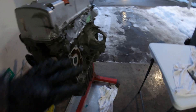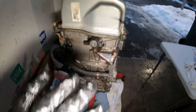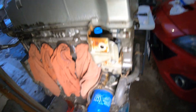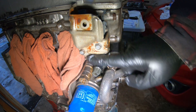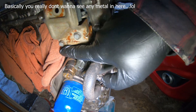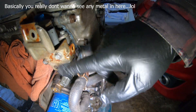I've gotten the water pump housing off. I'm gonna pull the VTEC solenoid next. I wanted to show you this - this isn't going to be an entire disassembly video because there's tons of those online for this motor already. But this is important because there's a filter in here, and the condition of this filter tells you a lot about the condition of the motor. I'm gonna pull this off and we're gonna see together what that little filter looks like in there. Hopefully it's not sparkly. Hopefully it's clean.